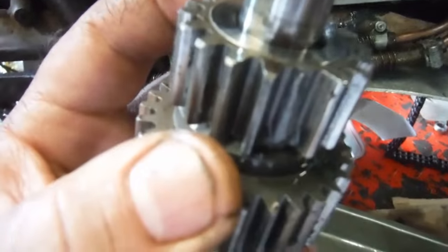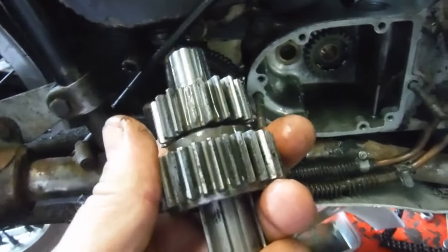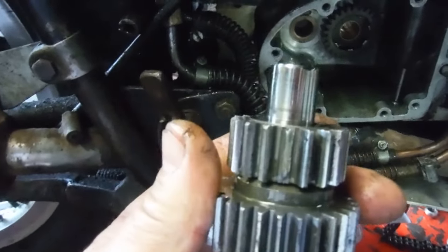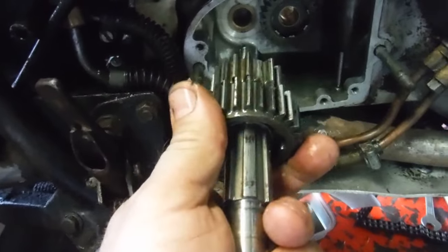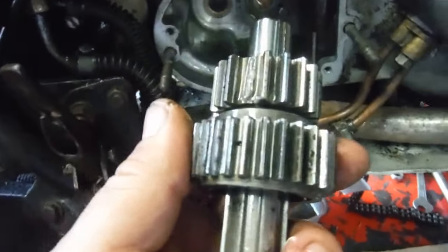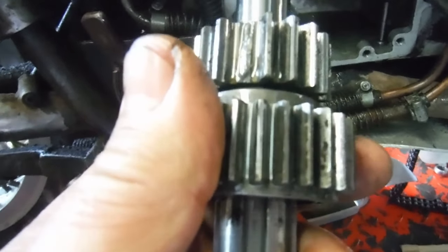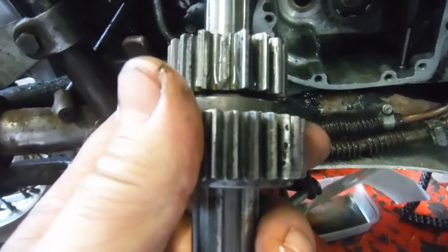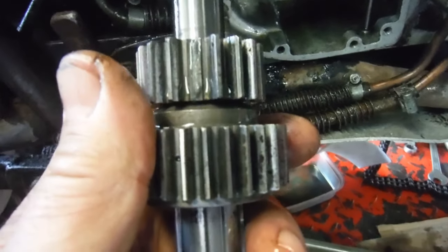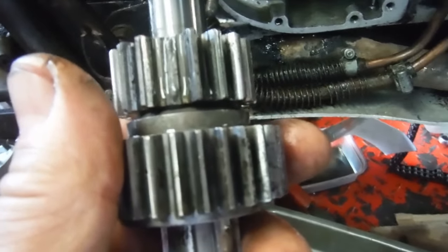I think the camera picked it up as well. Perhaps when I first rode this, the noise was coming from the chain and chain guard. More recently, I put this lay shaft in and turned the rear wheel steady at the end of the shaft, and you could get the knock knock knock. I put a painted mark on one of the gearbox sprocket teeth and turned the wheel in neutral, expecting the knock to happen every time the painted tooth came round a certain point, but it was actually going round faster than one to one.